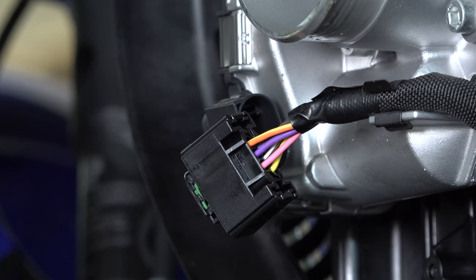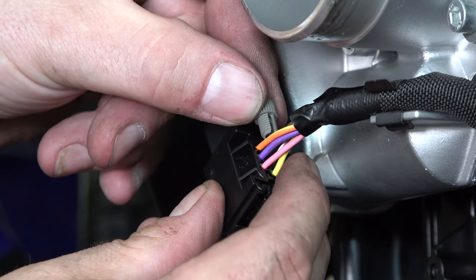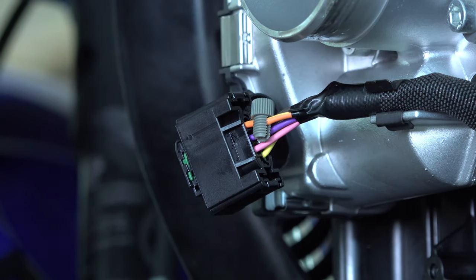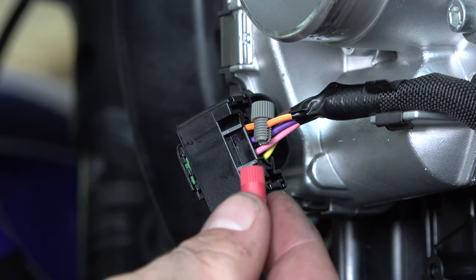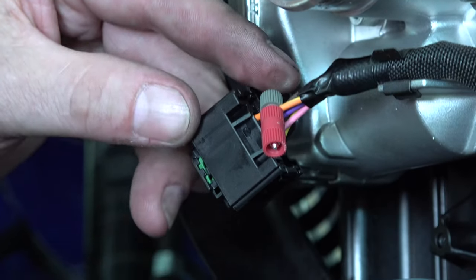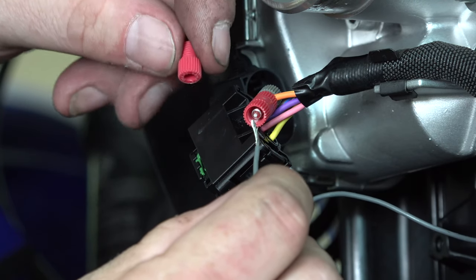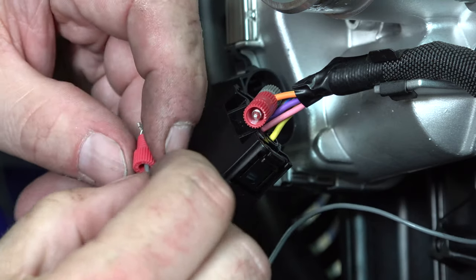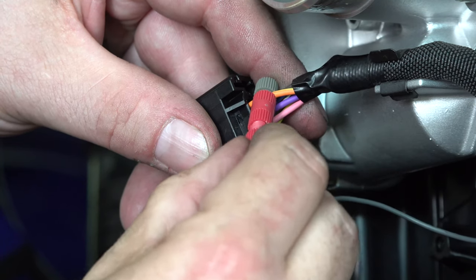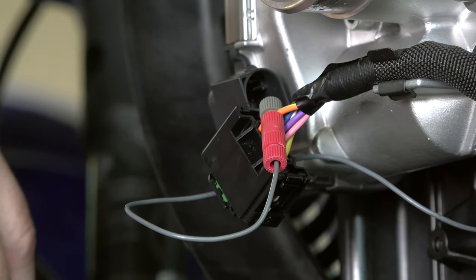This plug we disconnected in our airbox — we're going to take that gray part of the connector and fit it in the grooves over the yellow and orange wire. Now he's going to take that connector with the pointy sharp part and screw it on, and it will tap into that wire. He's got the last part of the plug — he's got his gray wire, he's going to slide it up through the channel until it comes out the other side. That end is stripped to bare wire, and he puts it in there, threads it in, making sure the gray wire stays up in there. And that connector is now installed.